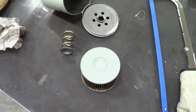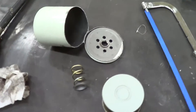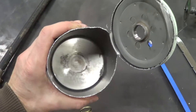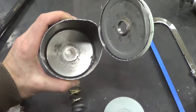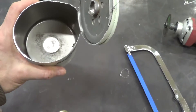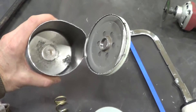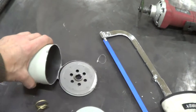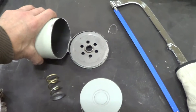My high-pressure electric fuel pump was making a whining noise, and I thought maybe that had to do with the fuel filter being clogged, because that can cause the pressure drop through the fuel filter to be too high, which makes the fuel pump cavitate and make a whining noise. Fortunately, although I'm old, I can still hear into very high ranges clearly. Swapping out the fuel filter did get rid of the high-pitched whine, so that must have been the culprit.